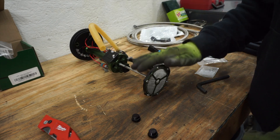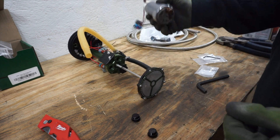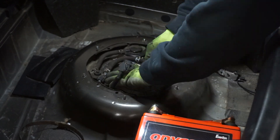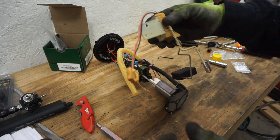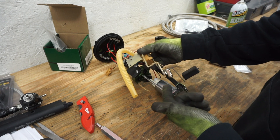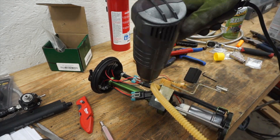Let's get it done. I'm going to get the fuel pump hanger ready to put in the car. I will have to put my fuel level sensor on here once I get the one out of the car — I bought this used. It was set up for three pumps; I'm only going to do one for now. I just pulled off the OEM fuel level sender, so I'll get this mounted up. The Supra also has a fuel temperature sensor which I don't think I'll be using, but it's cool that it has it.